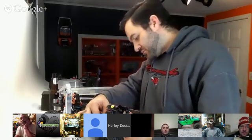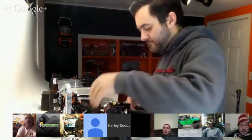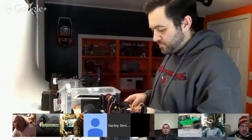I was like, well, we have the 35 turn. We bought a 30 turn and a 35 at the same time, and the 35s were rocking and rolling, but the 30 turn's not. So I thought, maybe it's just geared wrong. So I put a 14-tooth pinion in there, so it's under-geared and there's no drag brake. So I don't know what the deal is.